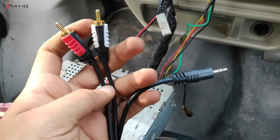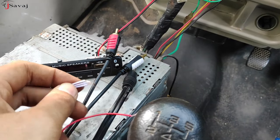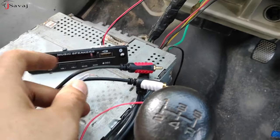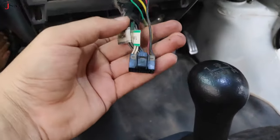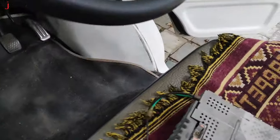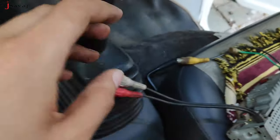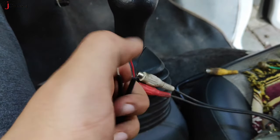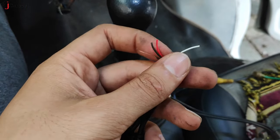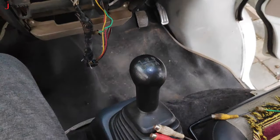This is the aux cable which I have shown you at the start. I will cut it here and attach these three wires to the aux cable, so that I have a socket-to-socket installation and no damage to the Kenwood system. This socket will easily connect with these wires. I have removed the dashboard. This is the wiring of the audio system and the power output from the wire. The four wires include two black, one white, and one red. The two black and red ones are connected to the side, and the red and white are for left and right speakers.